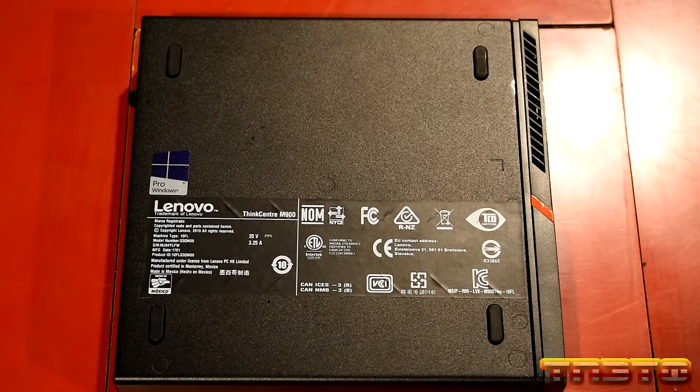So we have our 8 megabytes of layer 3 cache from our CPU, which is correct. It sees our 32 gig of RAM. It shows the current latency of it. It's not ECC RAM. You can view your detailed SPD. And as you guys can see right there, it shows the two Crucial modules. So those are reporting correctly. Pretty cool.